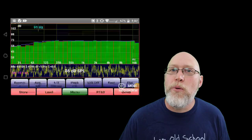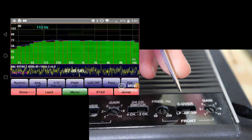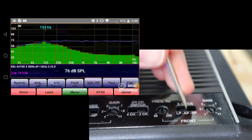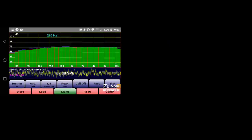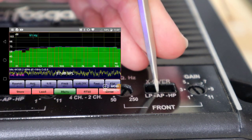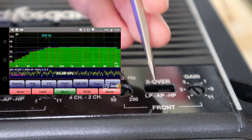Hypothetically, let's say you've got a factory subwoofer and you're going to use it as your signal source — this is what it might look like if there's a low-pass filter on that signal. I'm going to turn the low-pass filter on the amplifier on, and there we see it — this kind of setup appears in a lot of different cars. Many cars use a low-frequency driver in the doors that plays everything from around 500 or 250 hertz down. If you tapped into one of those and tried to get high-frequency content, you wouldn't get anything. Now let's turn on a high-pass filter — this is what you'd expect to see for a small mid-range speaker in your dash, where all the bass is rolled off.